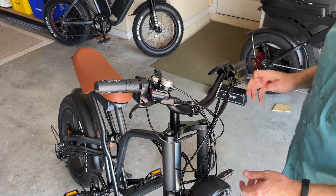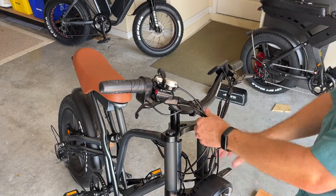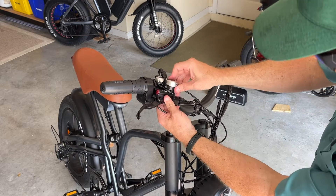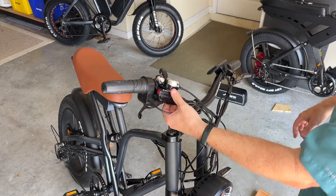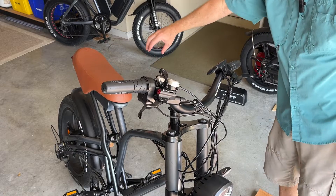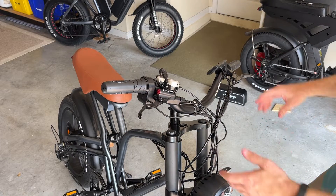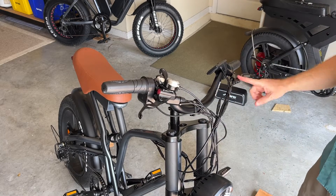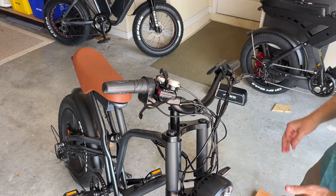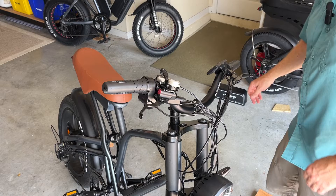I got that assembled and put the dust cap up here. I'm going to get these cables cleaned up and put the ties on. It's pretty tight already — I don't think I need to adjust anything. I'll go back to the rear brake and adjust it so it's not rubbing on one side. I can move over and do the front brake, but the front brake was back ordered — I might do that later. The assembly will be even easier because you don't have to route it through the frame, but it's the same essential assembly.